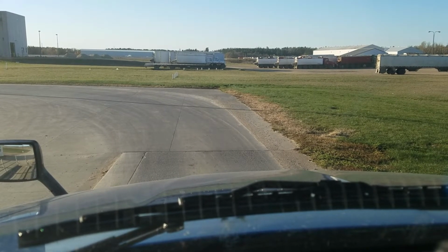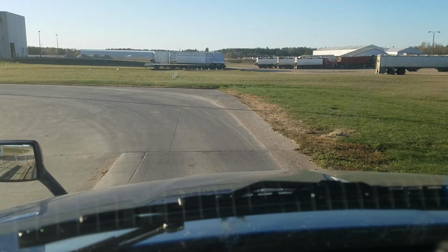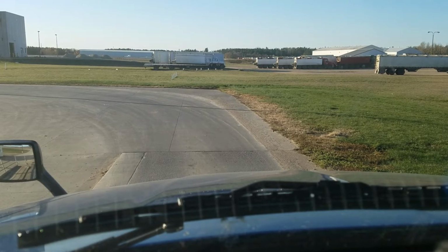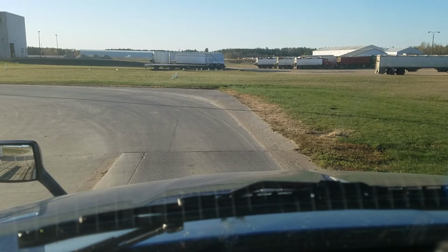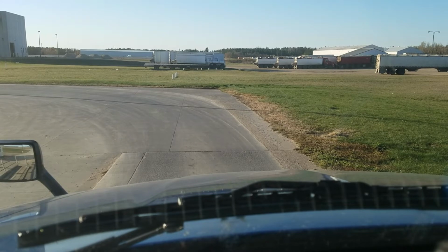Okay, here's what we do. You got your 45,000. Well, first of all, your steers were 11,860. Combination of your steers and your drives is 45,580. So you take 45,580 and you subtract 11,860 from that. And you get 33,720. So you're at 33,720 on your drives.